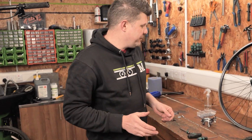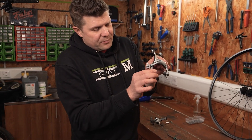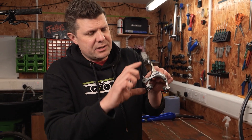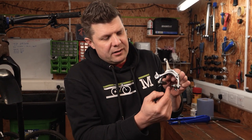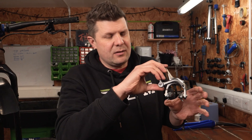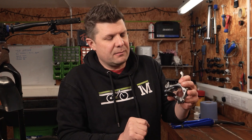Rim brakes are pretty simple, but there's quite a lot to check before you even start thinking about alignment. One of the biggest mistakes when lining up brake pads is rotating each pad individually to align them rather than activating the brake so both touch the rim at the same time. If you do it individually, you'll end up with a little ridge as the brakes wear that can rub the tyre. The best way is to activate the brake, get them working properly, get them lined up, and hold them in place as you bring them up to torque.